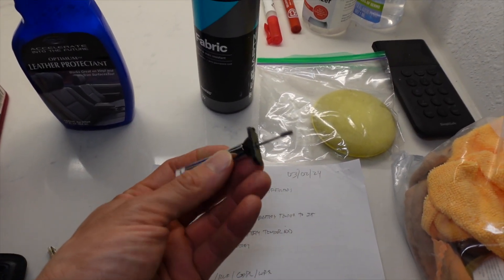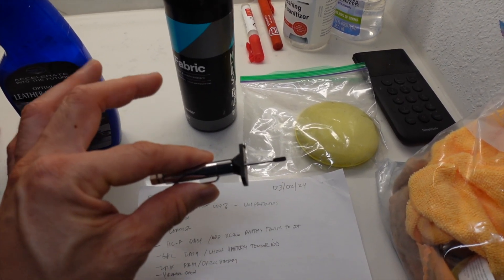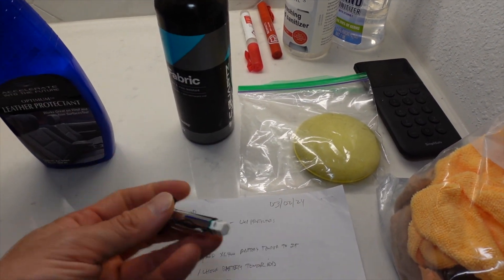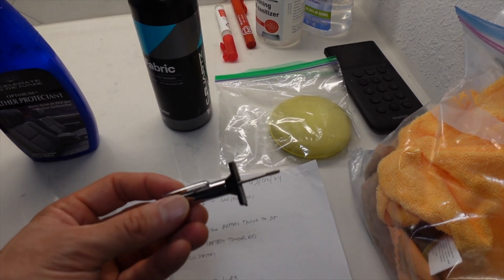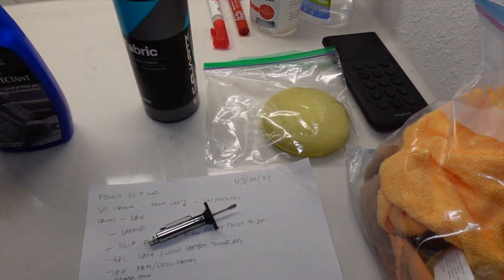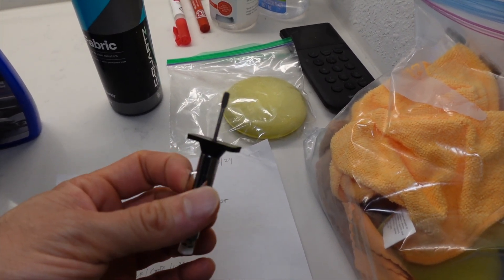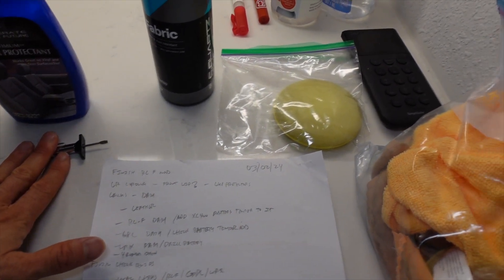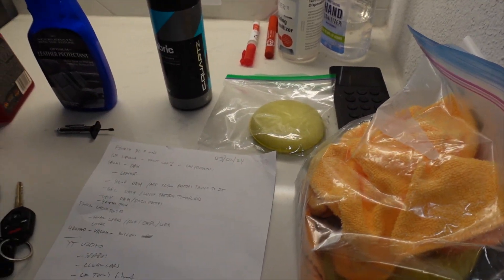I'm also going to check my tire tread depths for all of my cars. This is always good to do every three to four months — it's an easy way to make sure your tires are wearing properly and your alignment is good. Also, for my all-wheel drive cars, my GR Corolla and my WRX, you've got to make sure all wheels are within 1/16th of an inch of tolerance. No wheel can be more than 1/16th off in tread depth, otherwise it may screw up the differentials. I usually do a feel test along the treads to make sure they're wearing evenly as well.